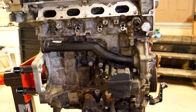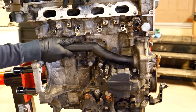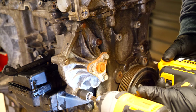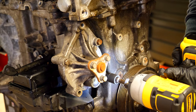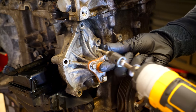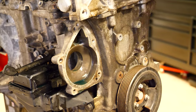I never removed the water pipe on the back side of the motor, so as soon as you pull it out, there will probably be a little bit of coolant — be ready to catch any fluid. With the water pipe removed, that should drain most of the coolant from the water pump. There are five bolts securing the water pump to the block, so remove each one and set them aside. Pretty straightforward.